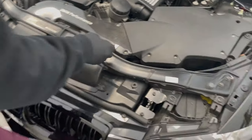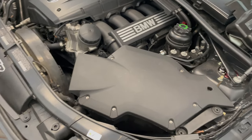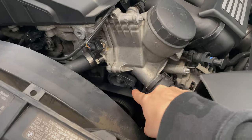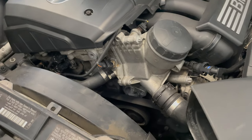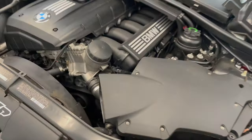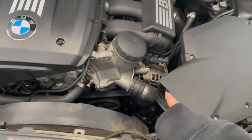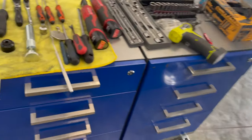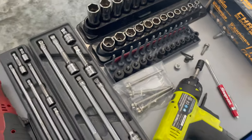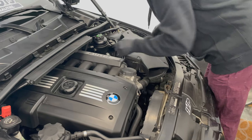So to get where we need to get, we're going to remove the airbox and then the alternator. We're going to try to go through the front — basically remove the airbox, remove the alternator, move the drive belt and pulley. We've got to remove the fan cowl, and then from there we've got all the access we need. If it gets to the point where we need to, I'll take the cowl apart and get the intake manifold off, but I don't think we're going to have to. We also want to mention that we have to replace the alternator bolts — they're aluminum, so they need to be replaced. This is not really a tutorial, sorry about that — it's really just a vlog, so sorry if we're not detailed enough.